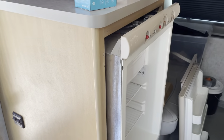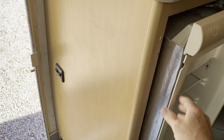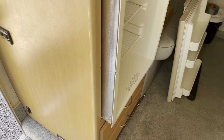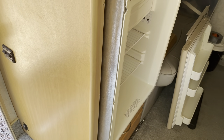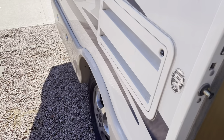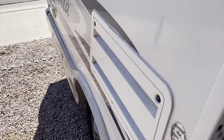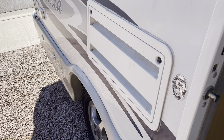So I'll take that apart, and here's the refrigerator. This is coming out — I just have to disconnect the gas lines and stuff. I brought the frame for the chest refrigerator with me so I can set it in place and see where it needs to go. The vent I was talking about is right here, so it will have adequate ventilation. This is also how I access the inside of the cabinet, so I'll be able to work on it from both sides.